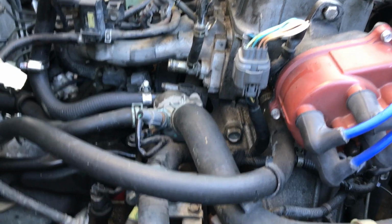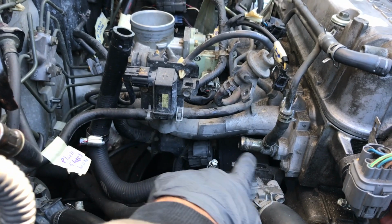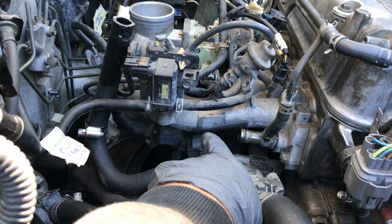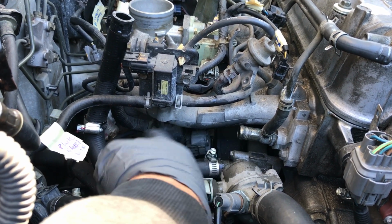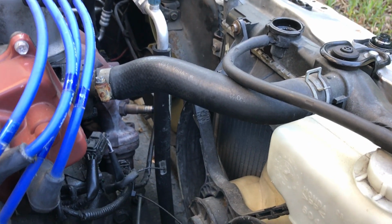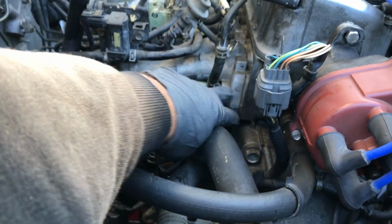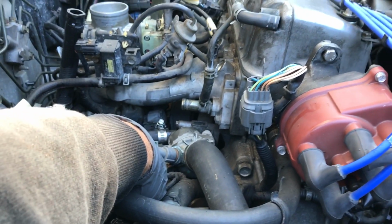Been disconnecting stuff, and I knew this was going to happen, but it's always more. This is the coolant line, just disconnected, just hanging out right here now. So that gushed fuel or coolant this way, and so what I've done is just drained the radiator down there. You've seen that in one of Rob's videos. Just did that, because once the intake comes off, it's still going to gush coolant out of here, so the less that's in the system, the better.